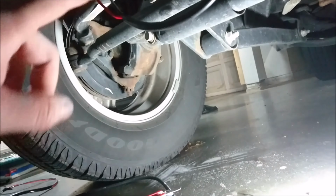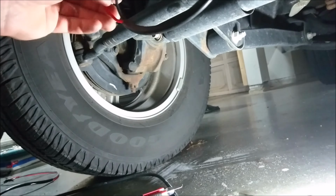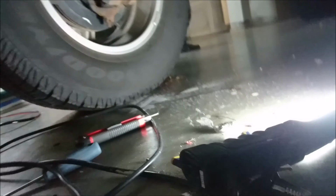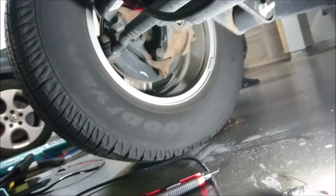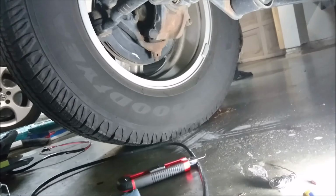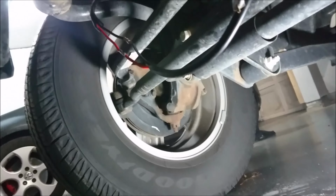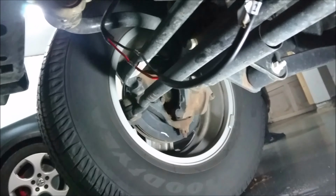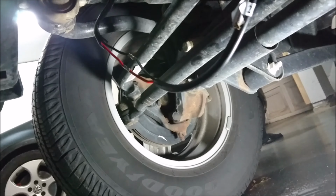So you could shove both the joints in here, but again, first tape these two, so tape them separately. First tape this, then tape this, and then if you want, you can either bundle them separately into each of their own heat shrink packs, or whichever way you want to do. Again, you could butt connect. It's all personal preference. I wouldn't really support butt connecting unless they're marine grade or something, because if these get wet, like if they get caught in a puddle of water or something, you don't want them shorting out.